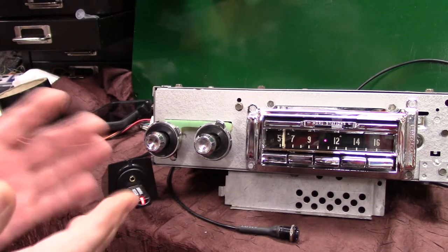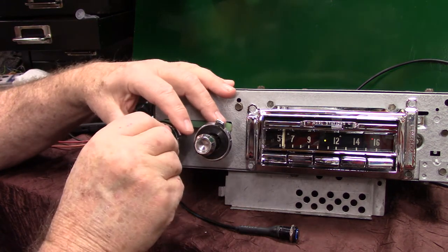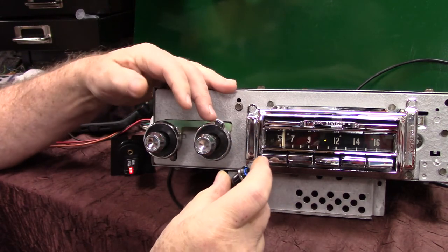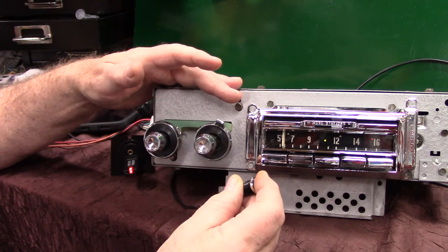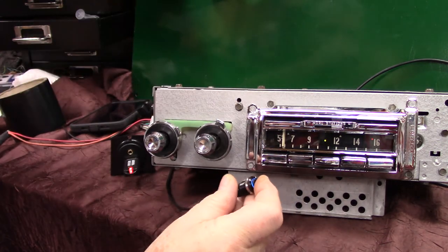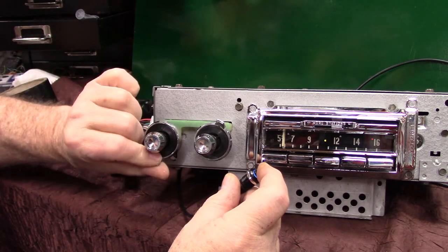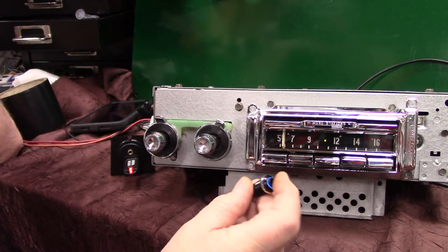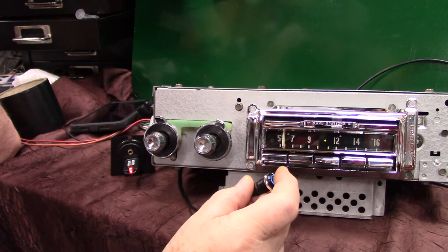Let's put it in pause and go back to radio. I'll show you how to work your EQ and crossover — treble and bass. Take the push button: turn on loudness and EQ by pressing one, two, three, hold — loudness on. Do it again: one, two, three, hold — EQ on. Keep holding it, then push once for EQ adjust. One more time for treble adjust. Go to your tuner control and set your treble on the EQ. That little pop tells you the center point. Treble set plus six dB.